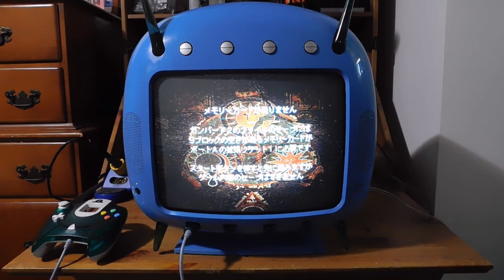In the end, what I did was I took the original Sega BIOS and reinstalled it in both this motherboard and in the other one that I was testing, and I got both of those consoles to go back to normal. So I know I've got a bad custom BIOS. So I just need to get somebody to help me out and flash that chip. And at some point I will install it into this Dreamcast.